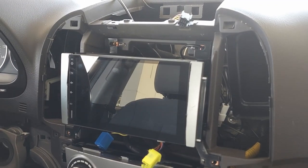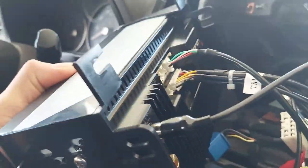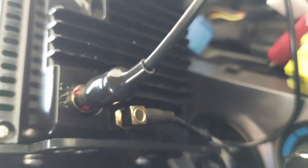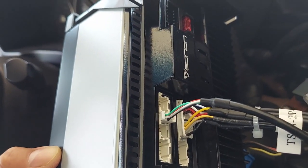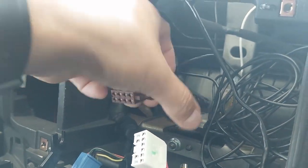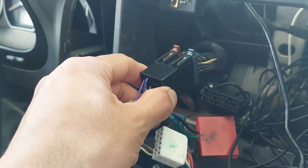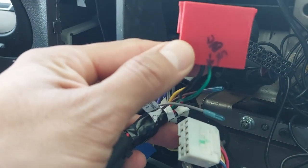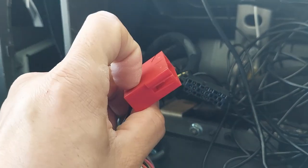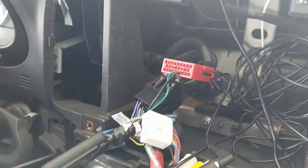It's time to put everything in place. We've got the radio — we tested the brackets, installed the antenna radio adapter, the GPS, and all the usual wires. The harness is going here. When the harness is connected, we're going to plug these connectors in. The gray and the brown connectors go here, and now we're going to connect the steering wheel controller that we just made. Make sure everything is right in place.